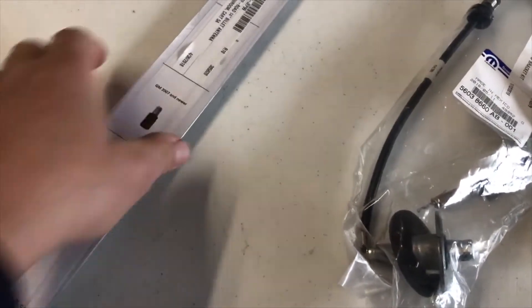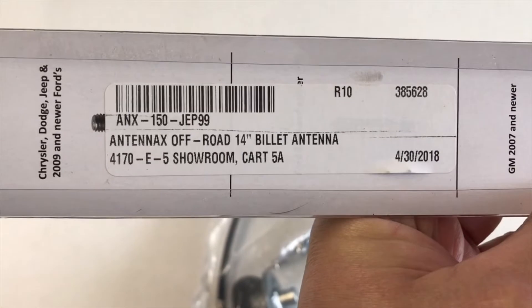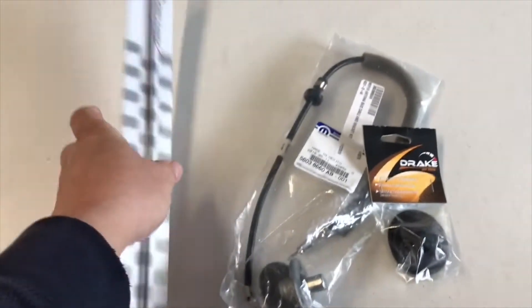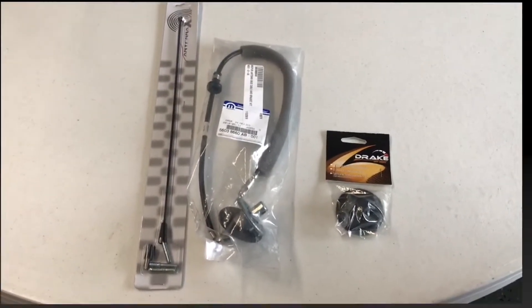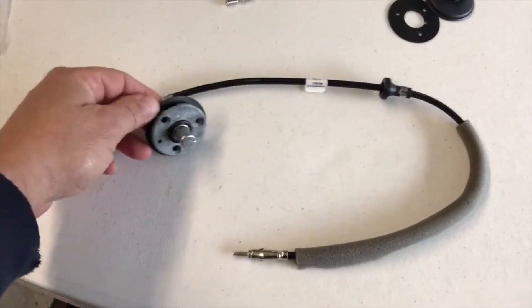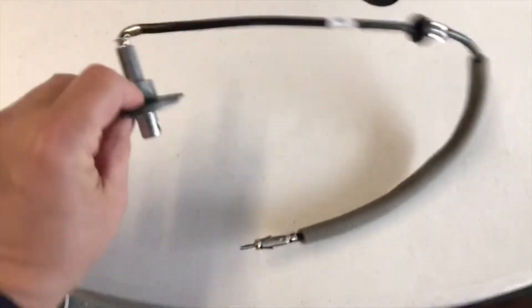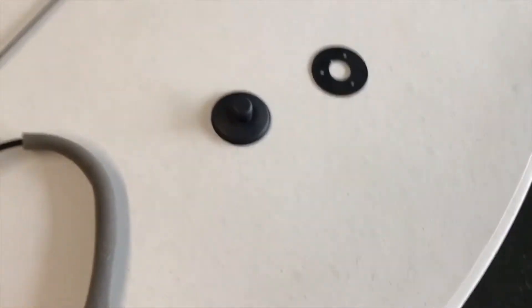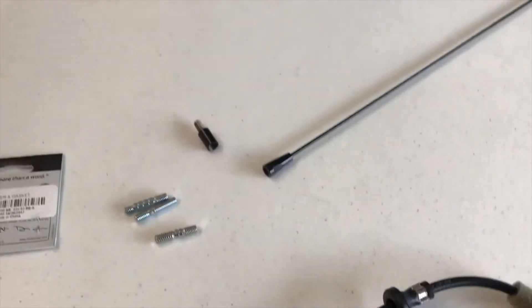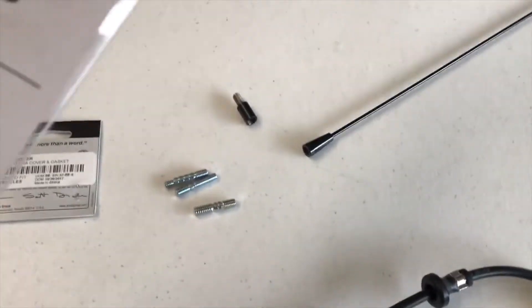This one just happens to be the 14-inch billet antenna. You've got to make sure when you're ordering it, you get at least these three components, or the kit includes all three. When you take all the components apart, you can see that this has a seal — the gasket — already on it. Make sure you line it up; there are three holes and a little slot, so it should line up very easily. If you have the cover, the cover has its own gasket, so you don't need that.